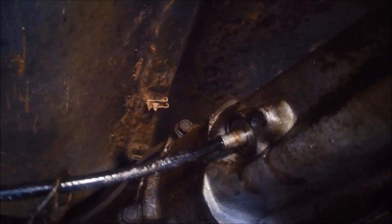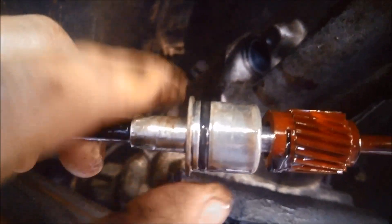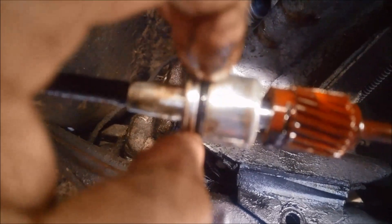So we'll start with the speedo. You can see the o-ring is completely flattened out, so it was leaking — it would just get the splashing oil there, but it's an annoying leak. So we'll replace that o-ring.